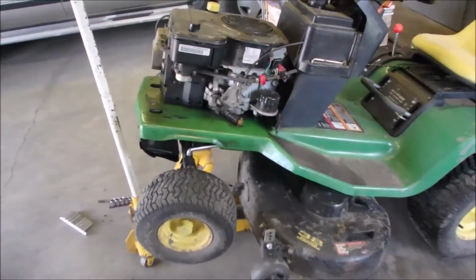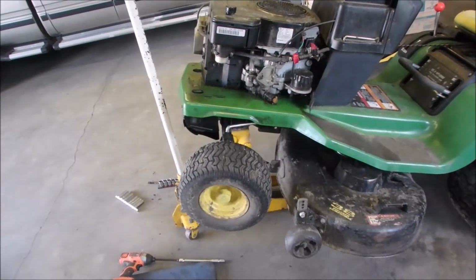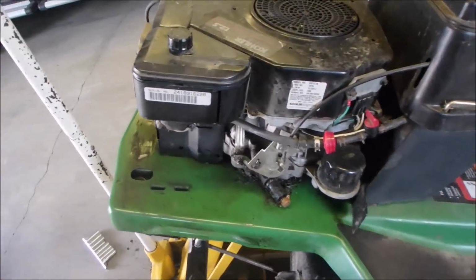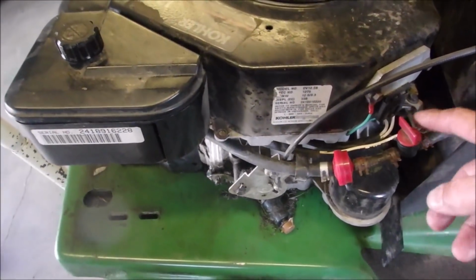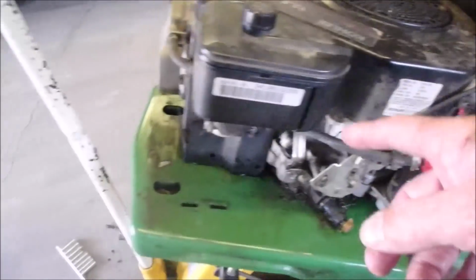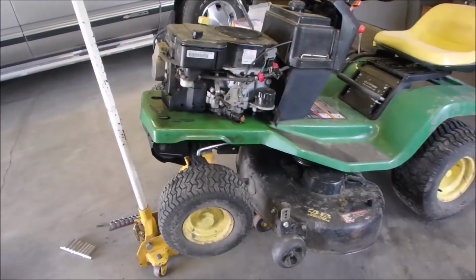Yes, my old friend the STX38 has come back. I think the owner said he went to start it up, and unfortunately for him, he's about a 2.5 hour drive away. But I think this gasoline block-off valve is leaking, and I think he's got gasoline in his oil. But he was smart enough not to run it very long.